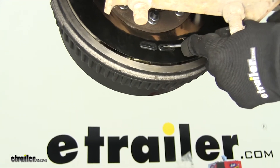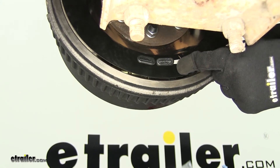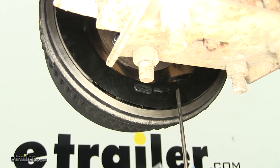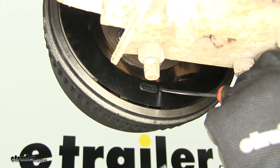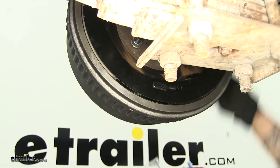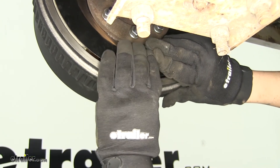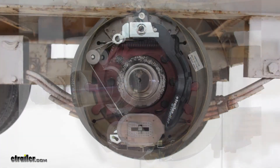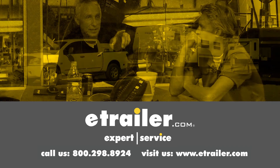On the back, we're going to have a couple of plugs — just take a flathead screwdriver and pop them out so that we can access the gear to make our initial adjustment for our brakes. We can either get a brake adjustment tool or a flathead screwdriver and turn that gear until the brakes are adjusted the way we want. Make a couple of turns, then spin our hub and see how much drag and movement we have. Once your brakes are adjusted, go ahead and put the plug back in place. That'll finish up your look at the self-adjusting electric trailer brake with dust shields measuring 12 and 1/4 inches for 10,000 pounds. Thanks for watching — click the link in our description below to shop, learn more, or visit us at eTrailer.com, and leave us a comment if you have any questions.